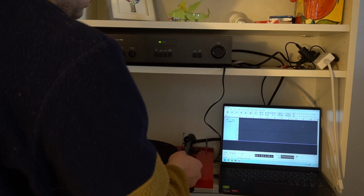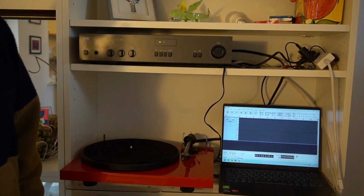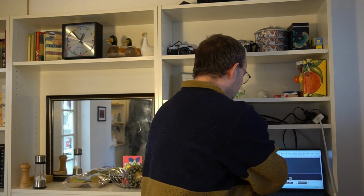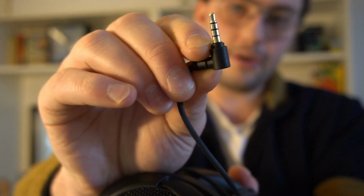Okay, I will spare you my off-the-cuff narration here and just tell you that I discover this isn't going to work, and you'll find out exactly why now. Righty-ho, so after a bit of tinkering and fiddling around with things off camera, I've realised this isn't going to work. The aux lead that I took from the tape monitor in the back of my amp and plugged into my computer, my computer's recognising this as headphones, which is fair enough because it's just got 2 rings, not the 3. So my computer is not knowing what to record from.